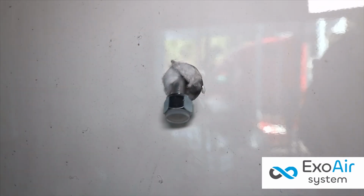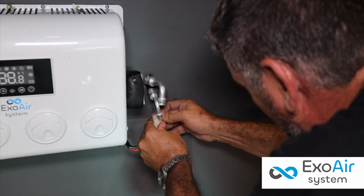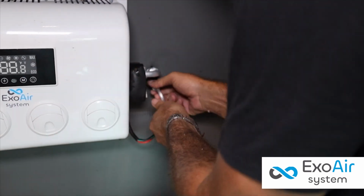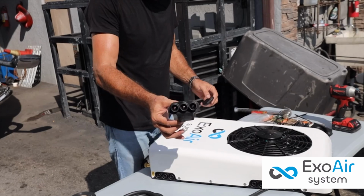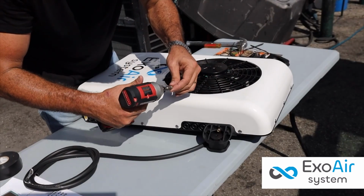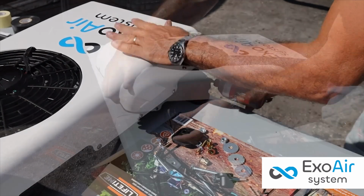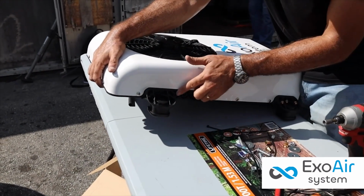The hoses are presented through the hole, and the cables from the evaporator equipment are connected to the condenser. The hoses are coupled and adjusted with the security plate. The pads or legs are assembled to minimize vibration from the operation of the truck. The screws are then installed to the sides of the unit in the position best suited to the space.